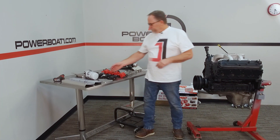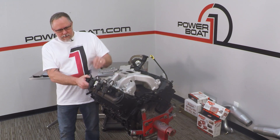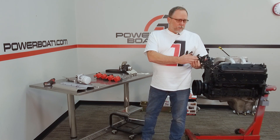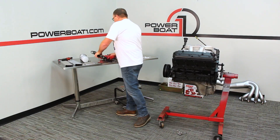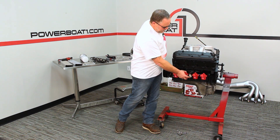For the coils, these are the stock coils. Normally they mount up on the valve cover, but we really didn't want them up there — that's kind of ugly. So we're going to take and put them down next to the engine. We're going to use the factory brackets and wiring harness, so this is basically the only wiring we're going to use from the original engine. Here are the MSD coils which are going to give us much better fire than the factory stuff, and that's what we're going to mount down there.